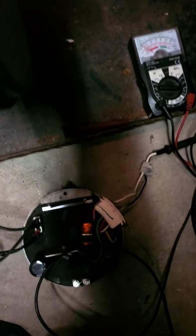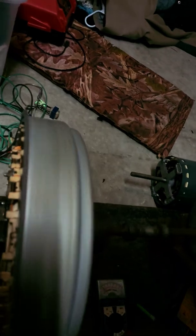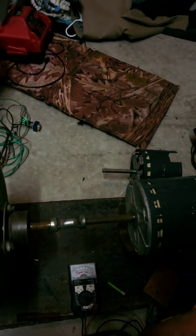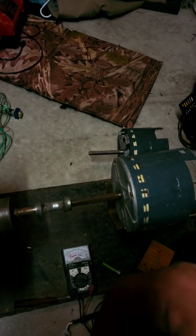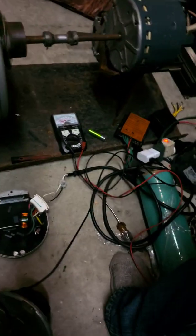This motor is not actually powered up right now. I'm just using it as a generator just to test the output. What I've done is taken one of the controllers — if you figure out the right inputs, which is usually 24 volts plus a high voltage, you can get it to turn the motor. It will actually run any three-phase brushless DC motor. This is the big washer motor from the Samsung washing machine. With the current setting it's on now, that's the most RPMs I can get. I just thought it was interesting how well it would run a much different three-phase brushless DC motor — to see how fast it would run it compared to how fast it ran the original motor. It was a lot faster, but this is a much bigger motor. It just goes to show you can use those controllers for anything.